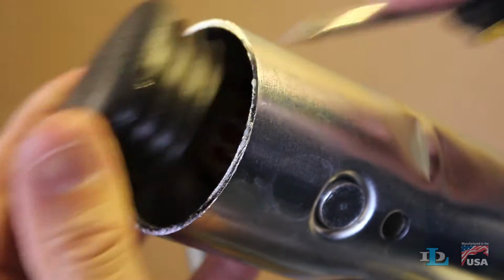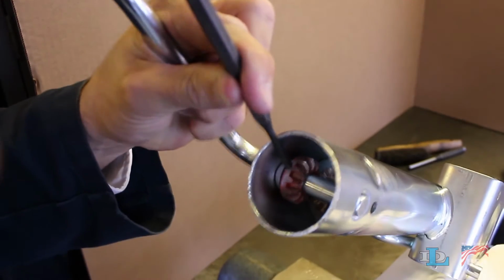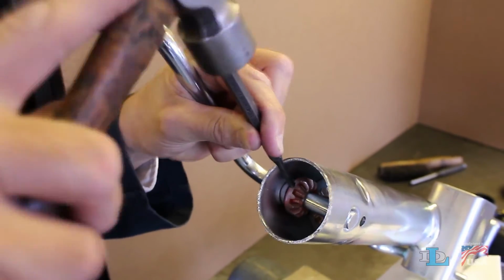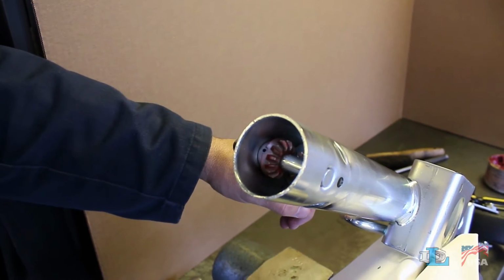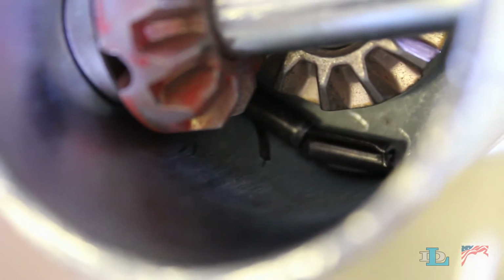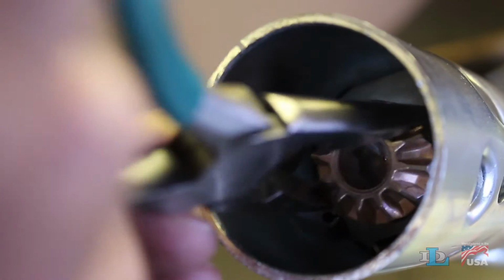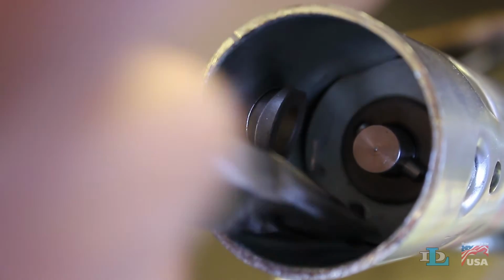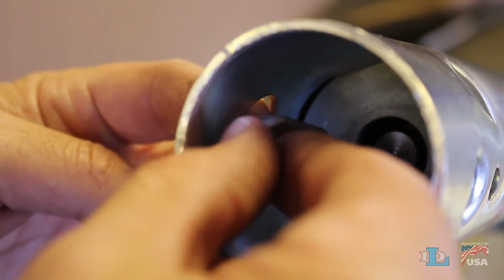After you remove the top cap, again angle the handle as much as your punch will let you, then knock out the roll pin as far as possible. Forcibly twist the handle until the roll pin actually breaks. Then use your punch to pound out the remaining piece in the same direction you were pounding before. Next, remove the jack's handle, both miter gears, and both pieces of the broken roll pin. Hold onto the wheel of your jack as you remove the dowel pin, the flat washer, and the handle bushing.